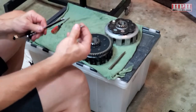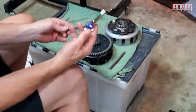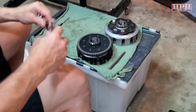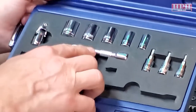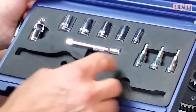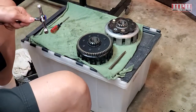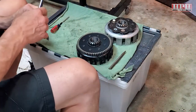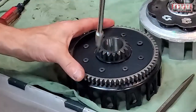The Wiseco kit comes with its own little Allen socket. Check this out — this is a tool we've just gotten recently, a T-handle quarter-inch ratchet. It comes with different extensions and attachments: 8, 10, 12, 13, 14 millimeter, a swivel, a couple of Allens, and two extensions. Very cool — I'll put a link down below where you can get one. T-handles are sometimes just quicker and easier to use than a regular ratchet handle. Anyway, you'll tighten these in a crisscross pattern.